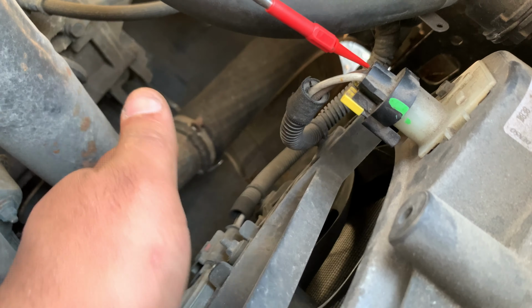I don't know, obviously you can't see underneath this layer. Let me get a new one. I've got a new one, aftermarket. And there you go, as you can see, 1.8 ohms. Oh, 1.8 ohms, sorry. 2 ohms. But there you go, this one is good. Yeah, the difference is absolutely minute. But this leg here is slightly wider, so I'm going to take off a little bit here. Got my brake file. Just going to trim a little bit so I can go into the hole there. Otherwise it won't.